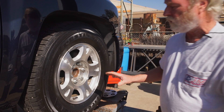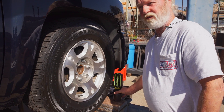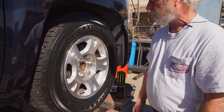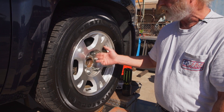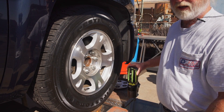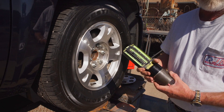The first thing we want to do after installation — this is a standard 07 Chevy with a four inch front kit, it's pretty popular for us. It doesn't matter if you have our kit or somebody else's kit; you can do your own alignments with a $115 gauge. If they're charging $90 or $95 for an alignment, take that money and go buy a gauge with it.